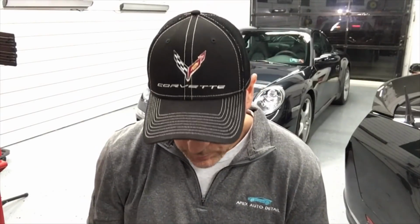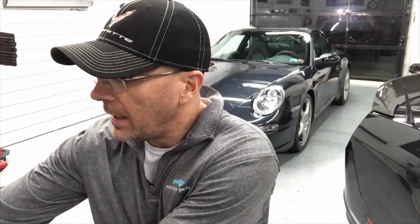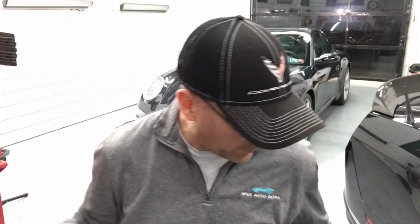All right, next question goes to Stephen Miller. He wants to know which microfiber towels I use for removing polish and compound residue. Again, that will depend on the type of clear coat I'm working on. If I'm working on soft clear coat, it's going to be something like the Edgeless, Jack of All Trades, or Eagle Edgeless. Doesn't matter where they come from. Without the edge, you don't have to worry about the stitching. It's plush enough to help reduce scratching on a substrate you already corrected.